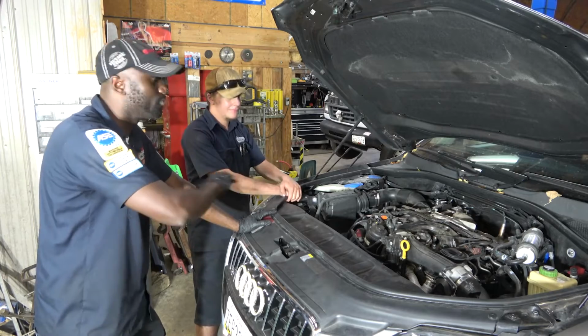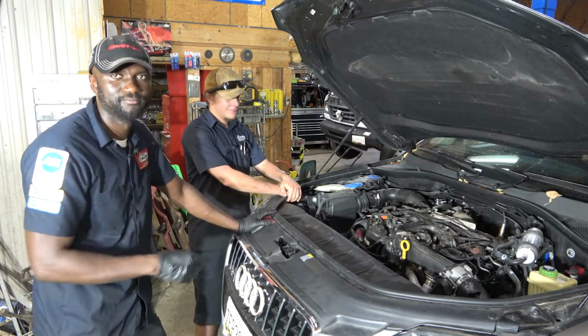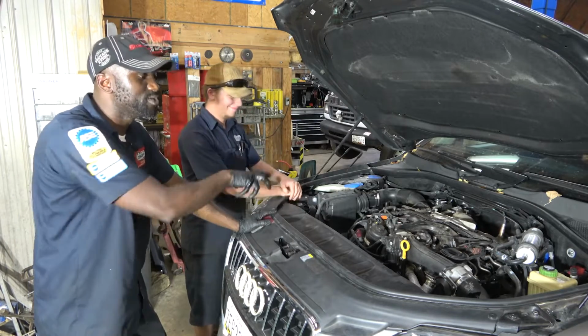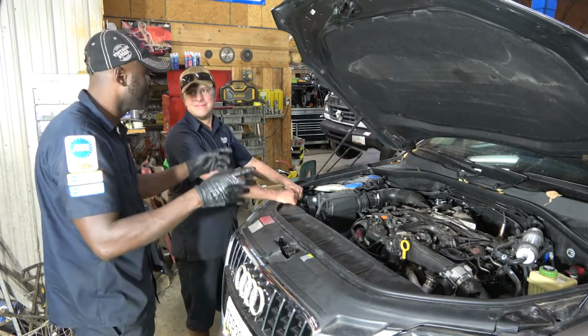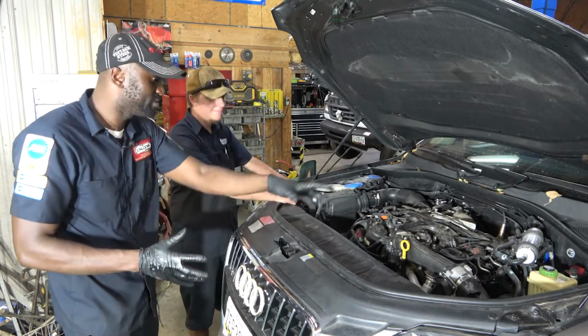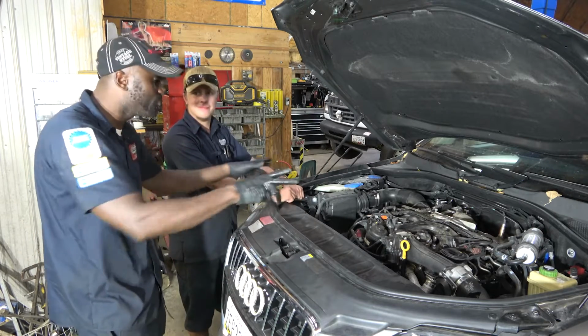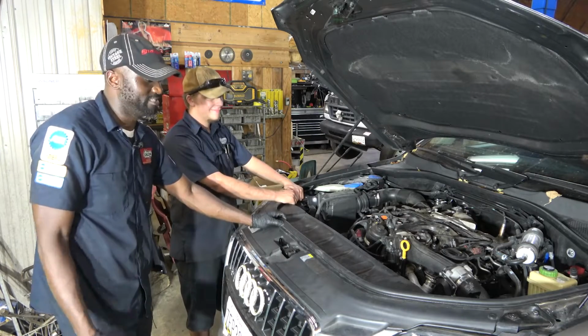These engines work the same way. You have a boost leak somewhere. And he didn't want to listen. He was like, no, it's a turbo. We checked it. I said, if you don't see a leak, use a smoke machine, smoke the induction system, and I'm sure you'll find a leak somewhere. He said, no, we smoked it, and there's no leak. It's the turbo. So it's very sad.